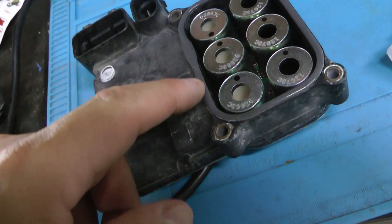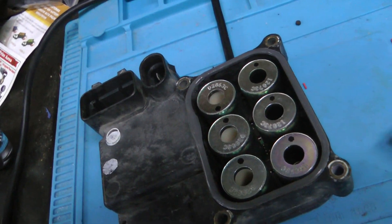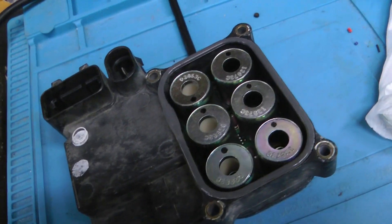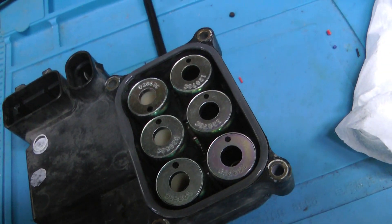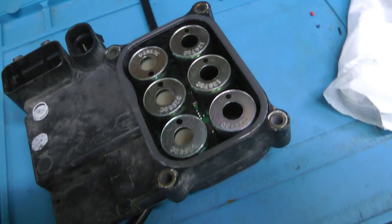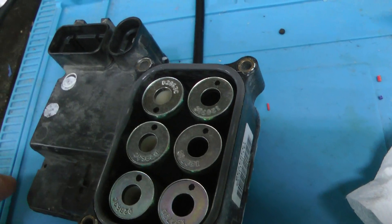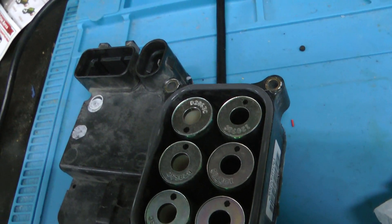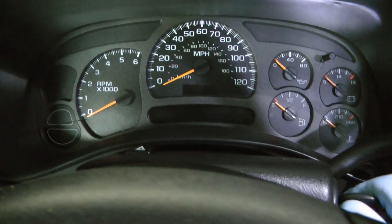I'm making an executive decision here — this looks like it's RTV, but it looks like what they did was put it on, let it dry, and are using it as a semi-reusable removable gasket rather than putting the RTV on and then mounting it to the vehicle. I hope that's right, but this looks like it dried before they ever put it on the vehicle. Because if I have to cut that off and put new RTV on, I don't know how cleanly it will stay given the location and trying to wiggle this into place. And the moment of truth.